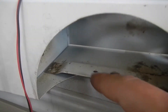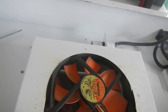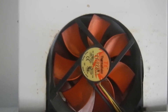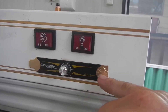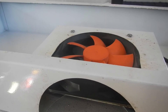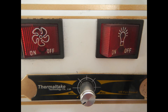When I first saw that this was all spot-welded and stuff like that, I thought it was going to be too hard to get that fan out. But once we just took those couple of nuts off, it comes straight out — not a problem. Our replacement fan is going to fit in there nicely — it's going to look something like that. We're going to get to use pretty much all of that fan, which is good, and the cutout is going to allow for good airflow. So that's in. We're going to have the little speed control on the front. That's our fan mounted in — it was literally just a case of holding the fan on top, drawing a couple of holes, and then screwing through into it. We've got our control plate mounted on with some super glue under it, so that shouldn't be going anywhere.